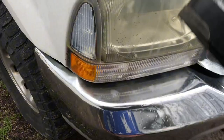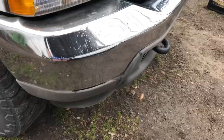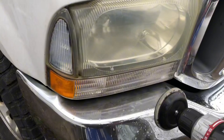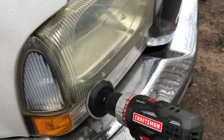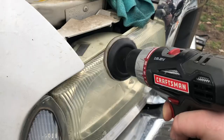This is 1500 on a new pad. I'm gonna do 3000 and then the polish. After 1000 grit we already got the 3K on, got water on it — work this back and forth maybe two to three minutes, then get ready for polishing. 3000 grit won't scratch it — it actually polishes and removes the 1500 grit sand scratches. Just keep on doing it like this, make sure you go fast.